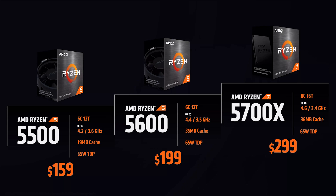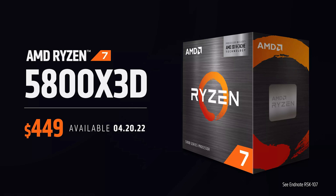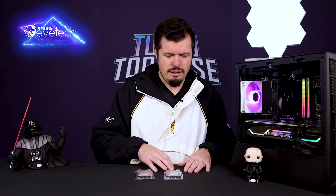So these three chips are kind of interesting. The 5600 is coming at a much more aggressive price point, and the difference between that and the X is going to be diminishing returns unless you water cool and do some overclocking and optimizations yourself with Ryzen Master — out of box it will be a very similar experience. The 5700X has been added at a sort of weird time. The 5800X 3D is going to completely eliminate the 5800X itself. These are both eight cores but in different veins. The 5700X strikes me as a really good bang-for-buck entry level development option. The 5800X 3D is really the highlight from this release series because of how they've done the caching system.